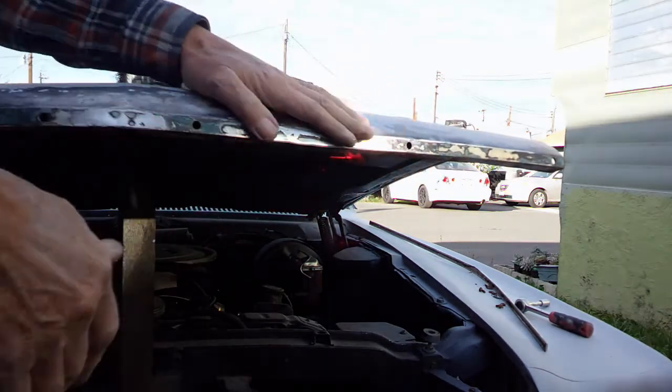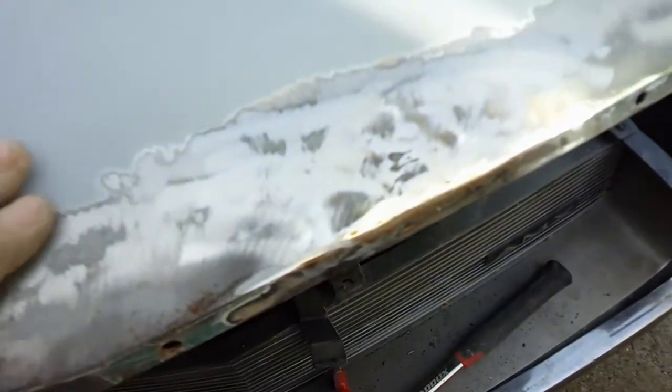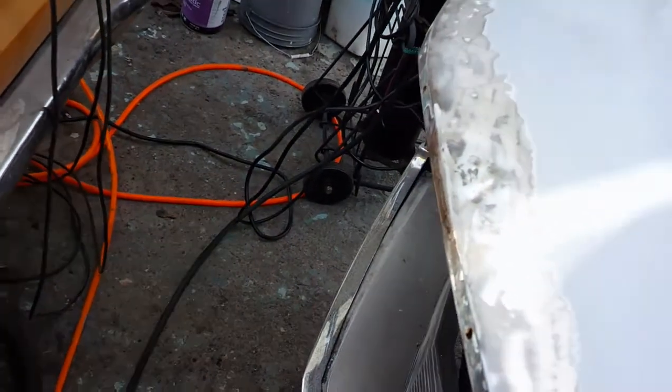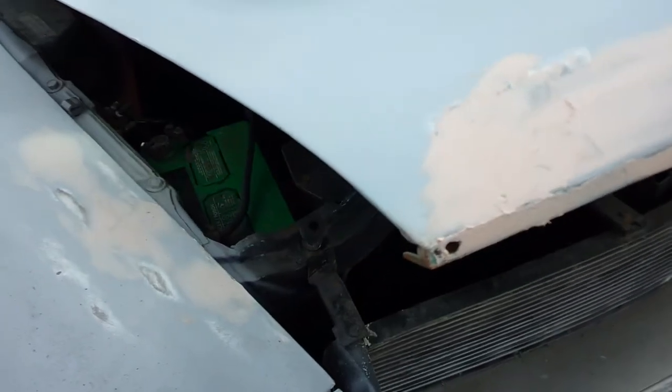But anyway, I have to bend the whole fender, the bumper, hood, but it looks pretty good. I'm glad I welded it, because now I just have to have a little thin skin of Bondo and not a quarter of an inch of that stuff, so it'll look fine. Oh, I didn't hardly take any Bondo. 2 or 3 spoons, and I just went over everything here. We'll just let that harden up, and I can sand it off.